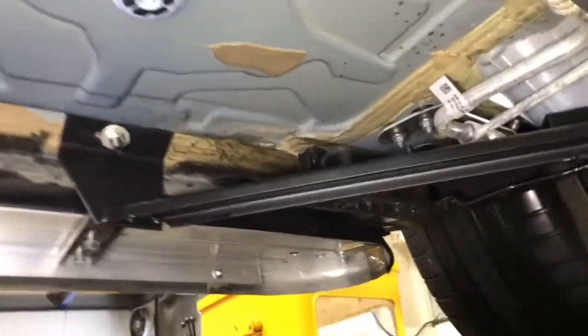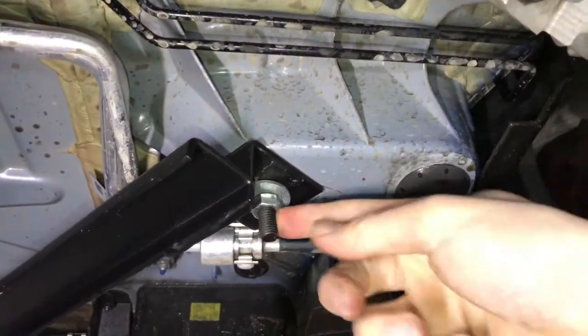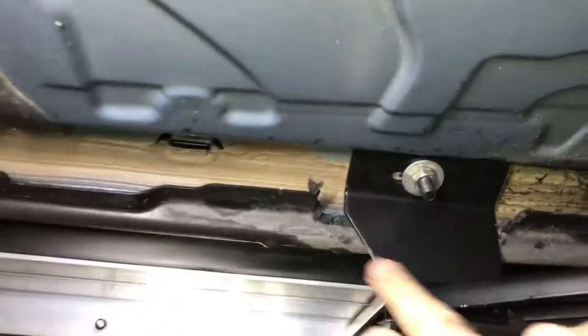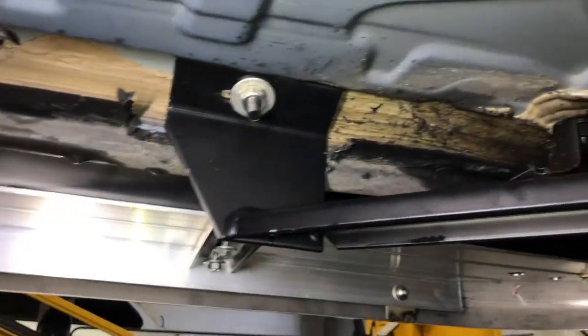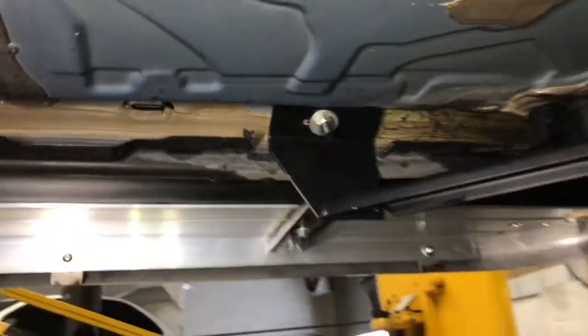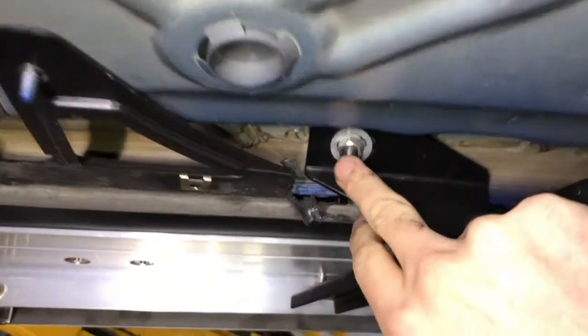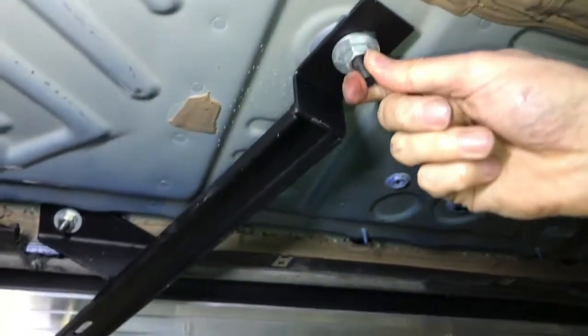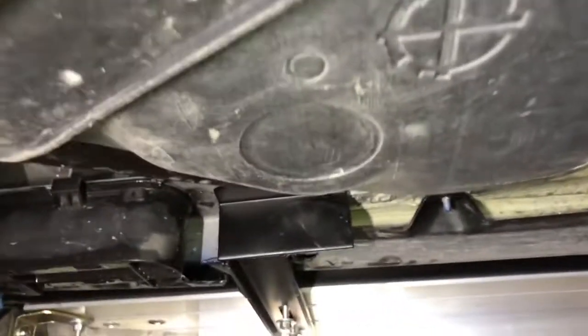And here's one I prepared earlier. Well, our fitter prepared earlier. So again, you've got the two bungs. The furthest back of those is the 10mm T-bolt that stays in. It comes back here. You see the section where it's cut out. Just makes that sit up easier. Well, I think you have to do it really in order to get it up. Now the middle bracket, again we'll cut out the section here, we'll put the T-bolt on, and at back here you've got this 10mm T-bolt up here. Super duper, and then you've obviously seen the rear bracket before, haven't you?